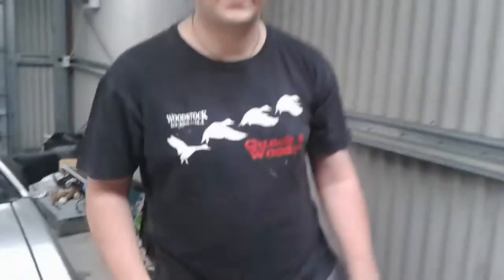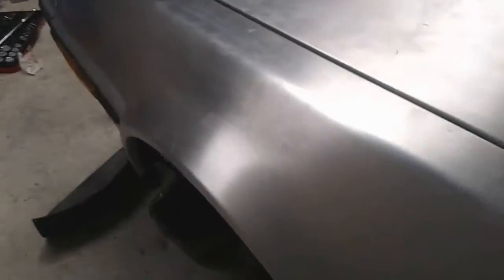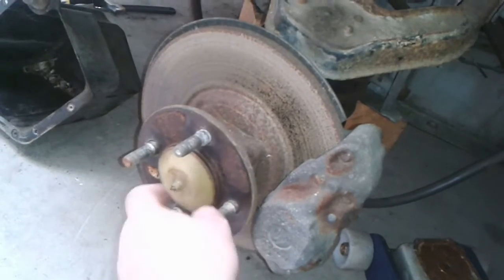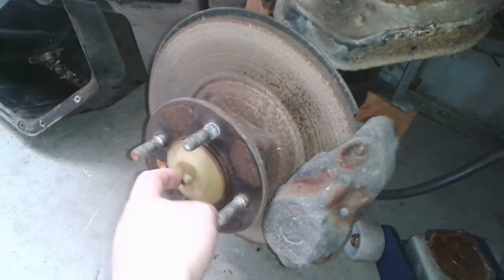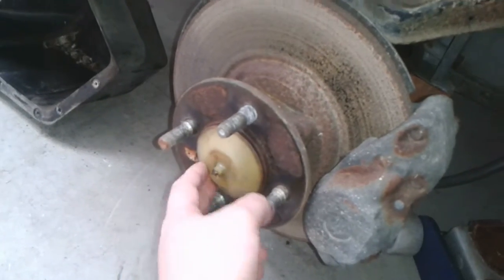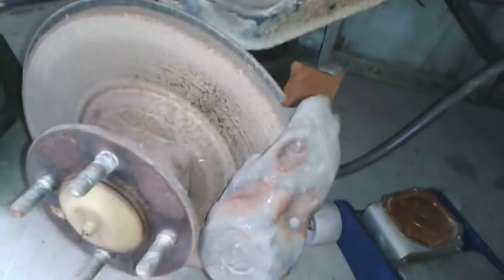So I'll give you a bit of a tour of what I'm working on right now. If we head down into where the wheel should be, you can see here — I think this has been replaced — the hub bearing. Because this looks new and it also has a very plasticky smell, whereas nothing else on the car has a new smell. The rotors are all going to need machining or replacing, the brake calipers need to be rebuilt, and you can see the suspension struts too. The isolator is very, very perished, so I'm looking at probably new struts and springs.